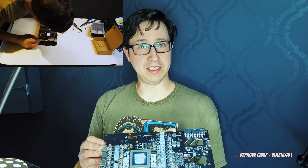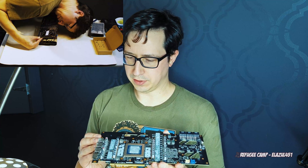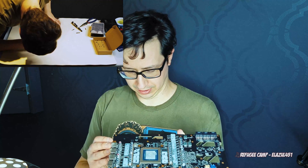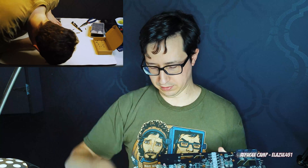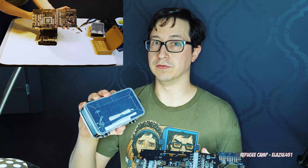So now, assuming that you've detached the PCB from the heatsink successfully and you haven't broken anything, or snapped out any of the fan headers, or broken a cap, or anything like that, now you can go through the meticulous process of cleaning it. As mentioned before, you will benefit from a microfiber cloth and some isopropyl alcohol. I will also note that a good small electronics repair kit will have scraping tools inside it as well, and you will make great use of those.